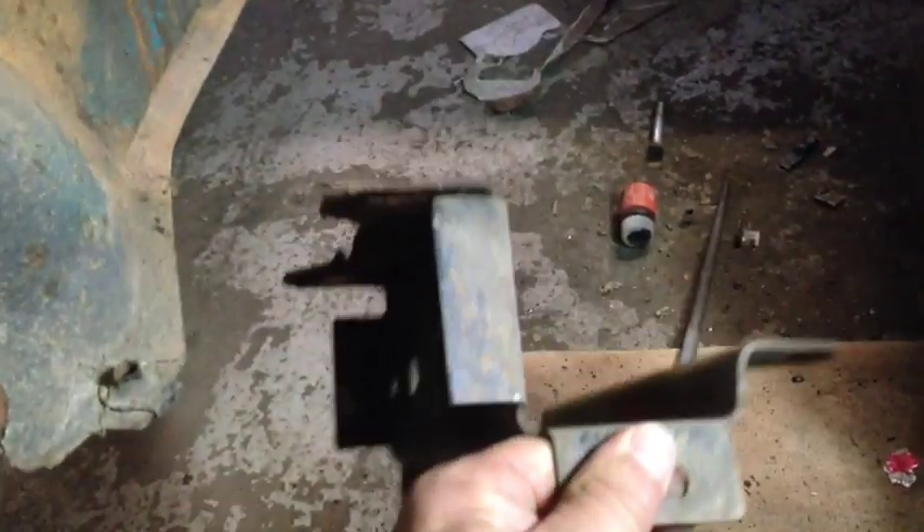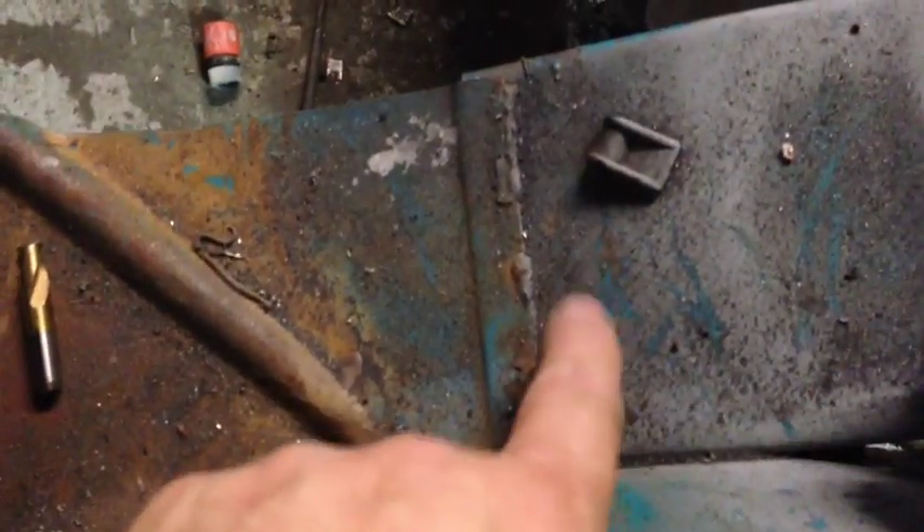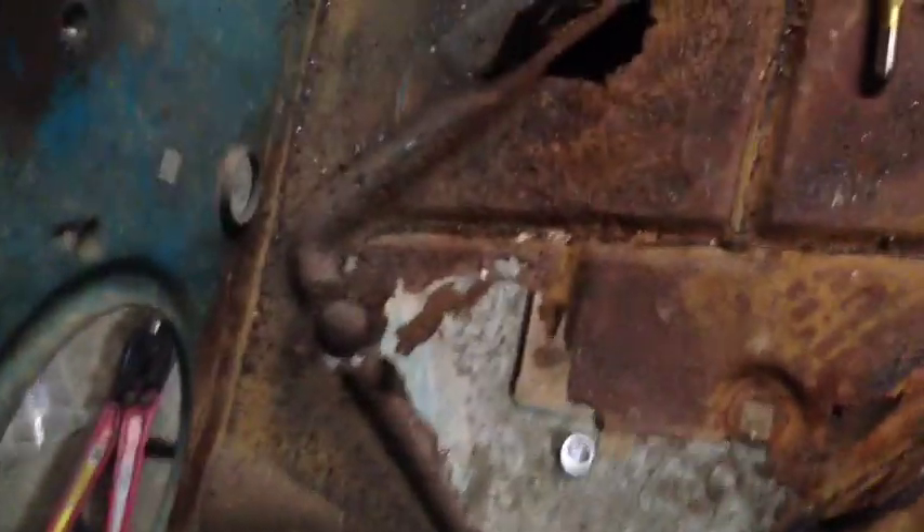Now off to the battery tray. To work on the battery tray I've taken out the support for the bumper bar. With the drill I'm just cleaning up the area so I can see where all the spot welds are, and I'll follow them right around. I'm going to drill straight through those and hopefully the battery tray will then pop out. I've got some welds to cut here - a little bit of hammering and it should fall straight out. Where I drill through to get the battery tray out, I'll use those holes as my spot welds or plug welds to weld the new one back in.